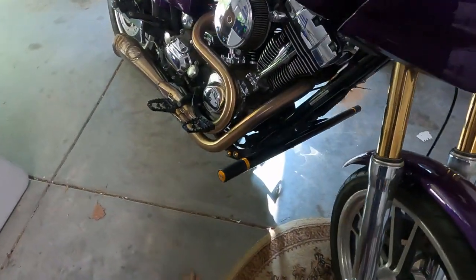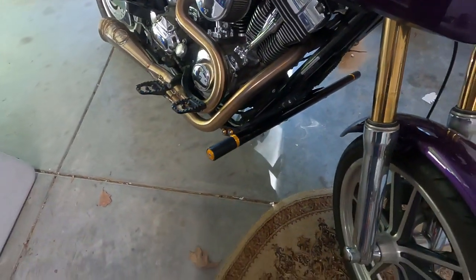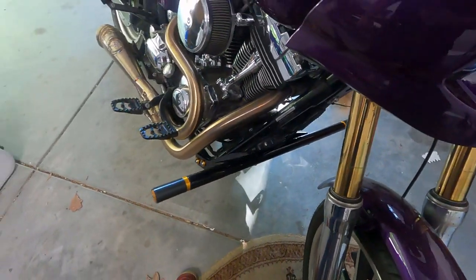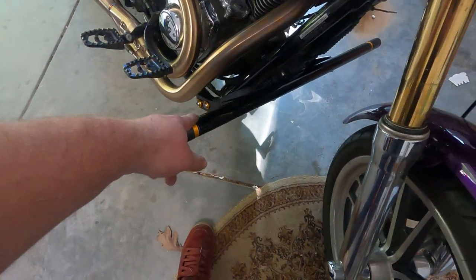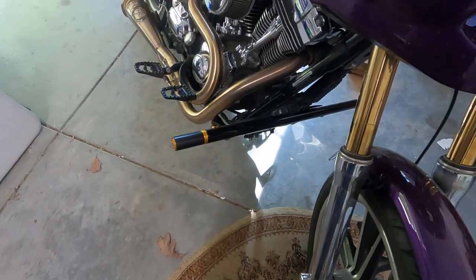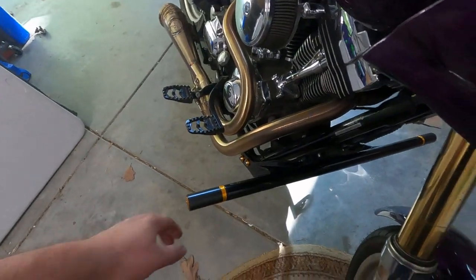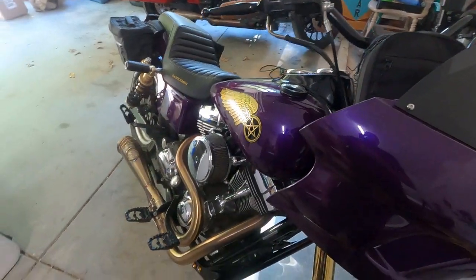All right, the crash bar is installed. It was very easy. We did use Loctite on all the fasteners. Probably saw that on some of it, but with Loctite here, there, and same on the other side. Got this little piece pushed in, super easy. If you do want to run without this, it will suck in the bike probably 3/4 of an inch, maybe a full inch, with less sticking out. But this should protect the tank, fairing, and handlebars.